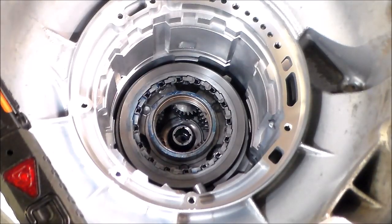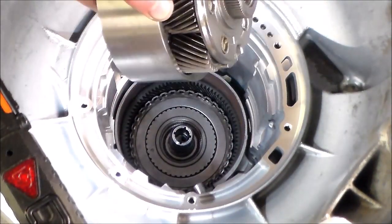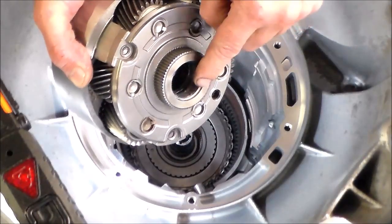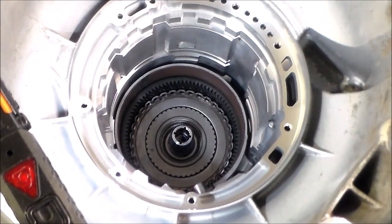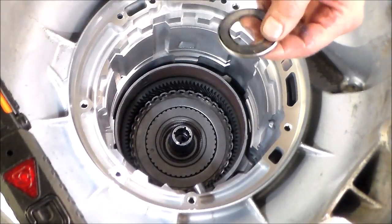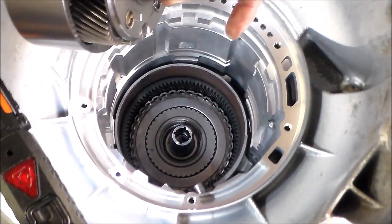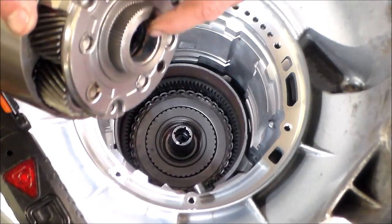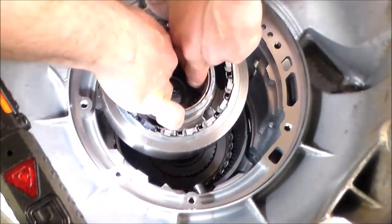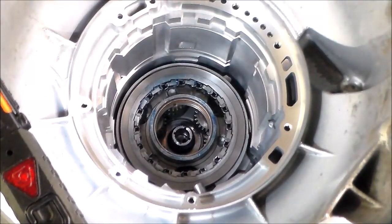You know what, I wanted to tell you something here. This bushing, you gotta countersink this bushing a little bit because of the bearing. Let me just get this piece here. All right, so this is the old bearing that goes on the inside of the direct drum. Okay, and there's a little lip on it. So you have to set it on top and just make sure the bearing lip and the bushing are not touching. So you have to hit the bushing down far enough to clear that. Okay, that went in very nicely.